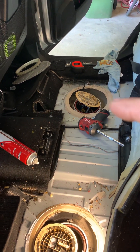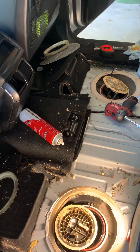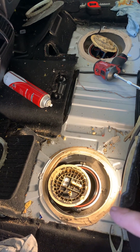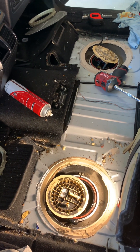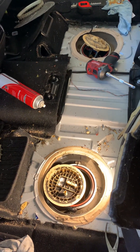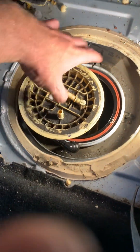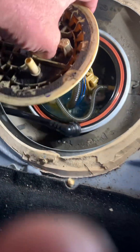Main pump's there — it pumps fuel across to this side, out through this line here off to the engine, comes back on this one, and from there the venturi line, when it's flowing fast enough, will suck fuel from this side of the tank to that side of the tank. I do have two senders, so there's a sender in each side — a sender there and a little venturi pump.